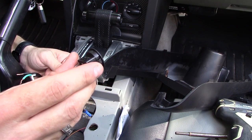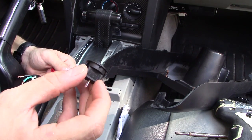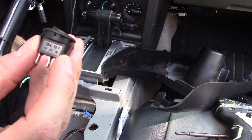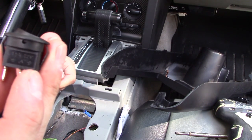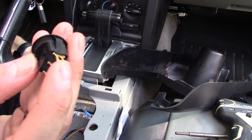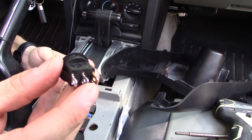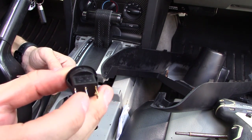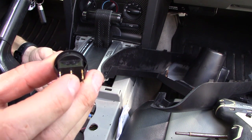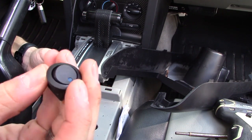And this has a built-in fuse, so if anything goes wrong, hopefully the fuse will pop in here or in your fuse box. It also tells you what is the ground and what is positive. That symbol with a bunch of lines stacked on top of each other — that copper prong — that is the ground. And these two are the positive. When you hit the switch, this is an open connection; this is going to open these two silver tabs, and when you close it, they bridge. And this is the ground to make the LED work.